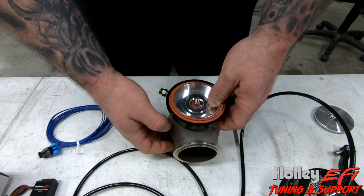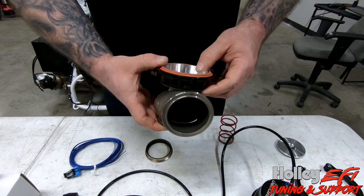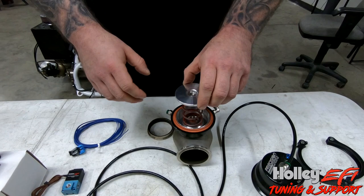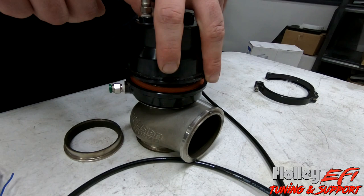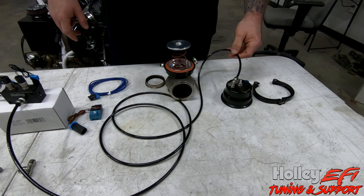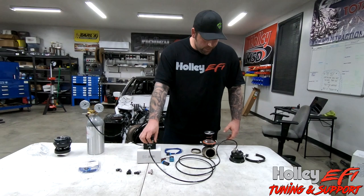What we're doing is using CO2. Some of you have been doing this for a long time and already know, but some of you are new to it, so I want to teach everybody from the start. We want to keep this shut. When the spring is not enough, we need to apply pressure to this cavity. When this is all tightened up it seals off, and we want to try to keep this valve shut with pressure. The fastest and most accurate way to do so is with CO2 and a good pair of boost control solenoids, programmed properly.